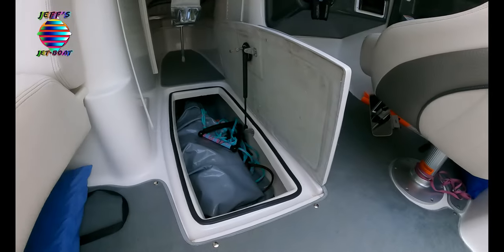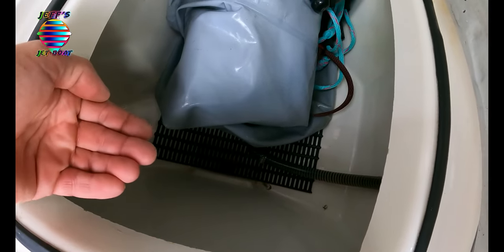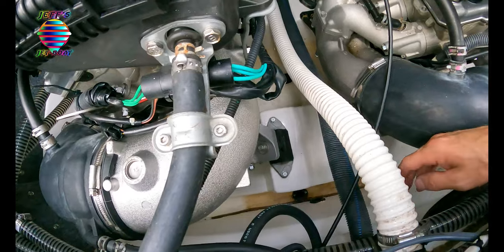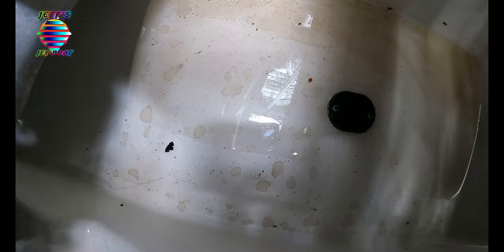What do they do? What's the point of having these in the hull? Well, this is just an option from the manufacturer. Yamaha believes in their wisdom that if you were to run over ground something and the hull starts filling up with water, it could eventually spill over into each one of these compartments. By keeping those plugged, water won't bubble up through it and fill this compartment out. Eventually the boat starts to sink - same thing for the engine bay below here. If I stick my finger through that drain plug I will eventually hit the bottom of the boat.